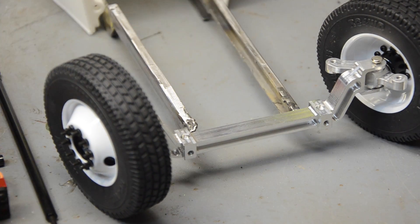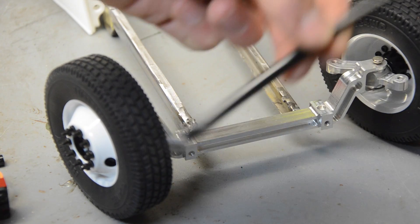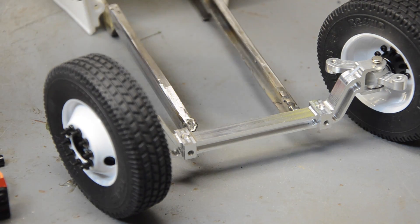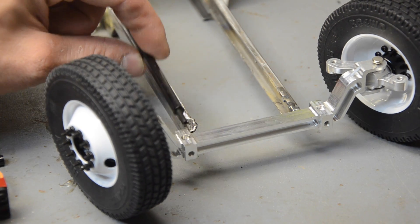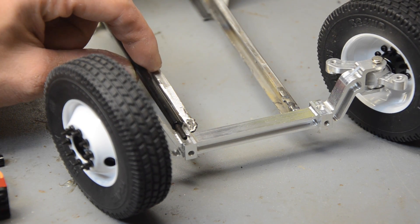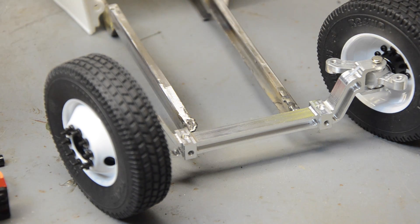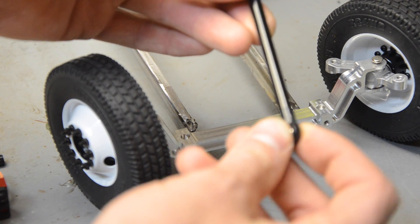The main reason is my front suspension. The chassis will sit inside the leaf perch part of the drop axle — this is a semi axle, an aftermarket one. These are going to be my front radius arms — I think 126mm — these are the rear links for a Gelande 2 D110, and they're going to be perfect for my front. The length I need for my wheelbase, and these will thread into the holes already made and threaded into the axle.